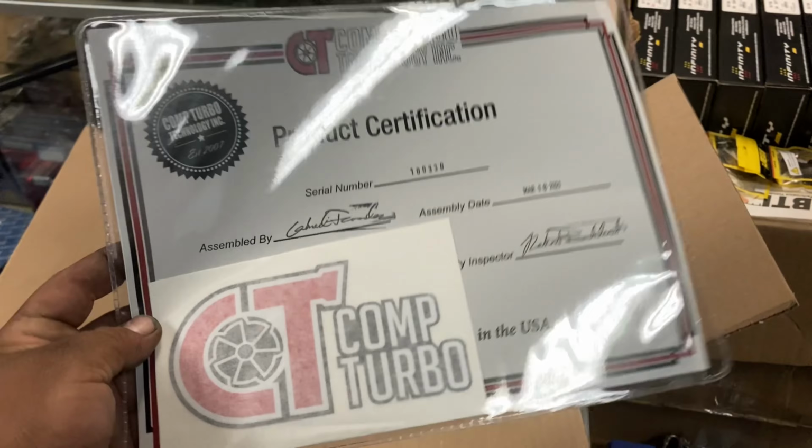Looks great. I already finished building my fully custom wiring harness. If you don't know much about me, I build all these harnesses from scratch and tailor them to the car of how we're going to do it. So I'll have my twin fan relays in there, my single fuel pump, because we're only going to be doing one in this car. The car's probably never going to go over 500 or 600 horsepower, won't need more.